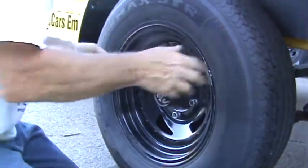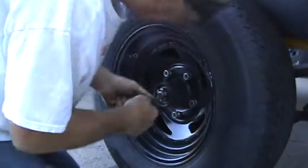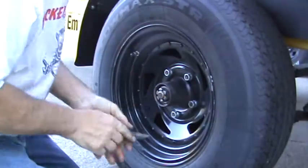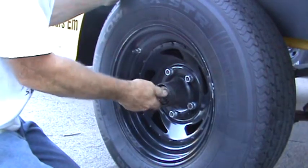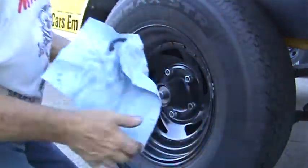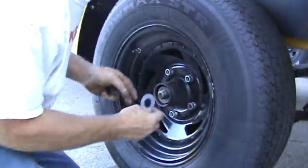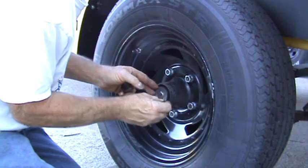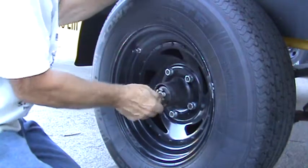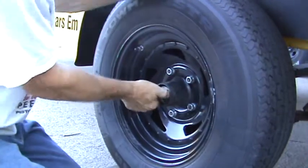You always want to spin it a little bit. It's going to take another combination here. The beauty about this kit, like I said, is you have enough of each combination to get it dialed in just right. This is a 25 thousandths, so we've got a combination of 50 and 25 to get it to that sweet spot.